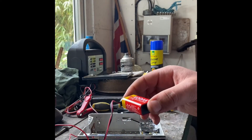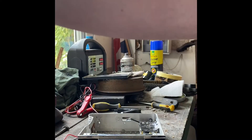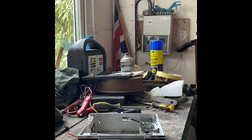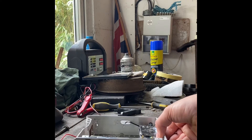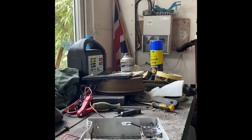At the minute I've connected a 9-volt battery because the unit runs from 5 to 24 volts, so a 9-volt battery works perfectly fine. Obviously when you connect it to the car — the Midget has one power lead — you put the positive to that and the negative is just your ground, so put it to the chassis or something like that. Hopefully that helped you.